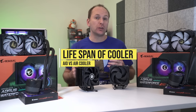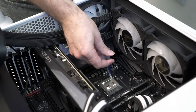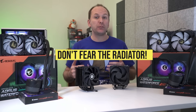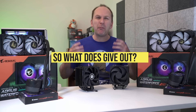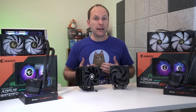In terms of lifespan, AIO coolers should last about six to eight years, while air coolers last as long as their fans do. I'd recommend repasting your CPU cooler every three to five years depending on your thermal paste rating. While AIO pumps can fail early and some can leak, this doesn't happen very often, and AIO reliability has improved greatly over the past five years. More likely is that the liquid coolant will permeate over time — essentially microscopic evaporation — until enough has permeated after about six to eight years that performance begins to degrade. Some AIOs can be refilled, so their limiting factor then becomes pump lifespan.